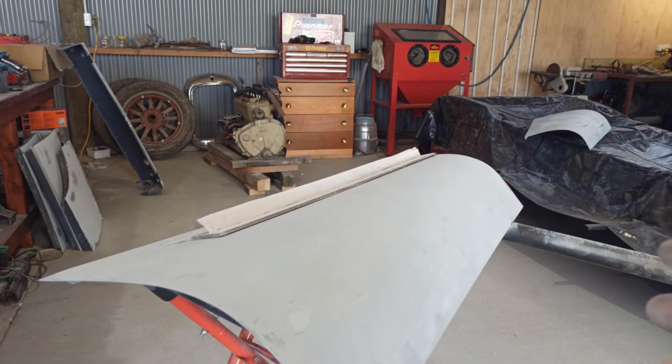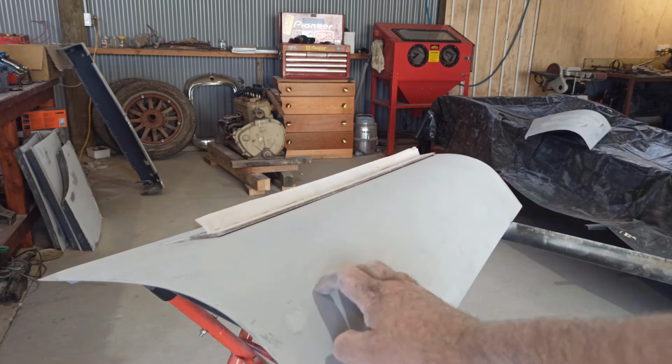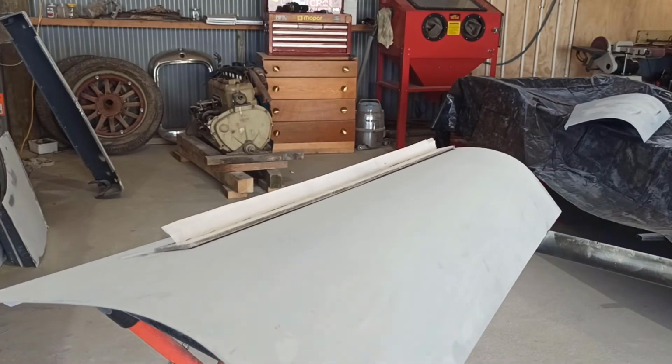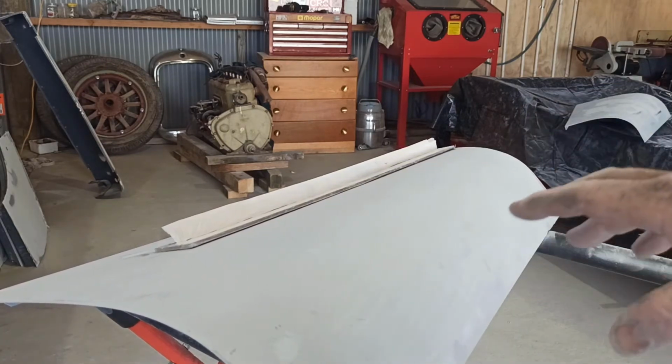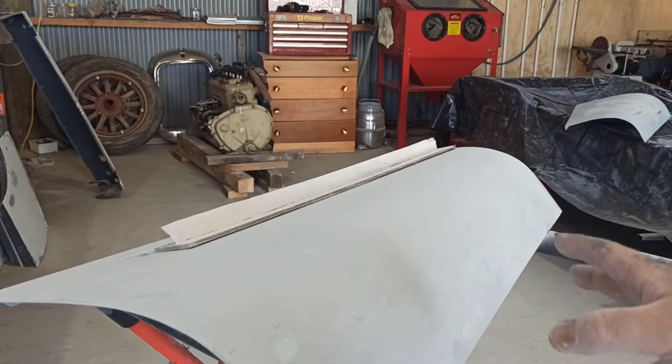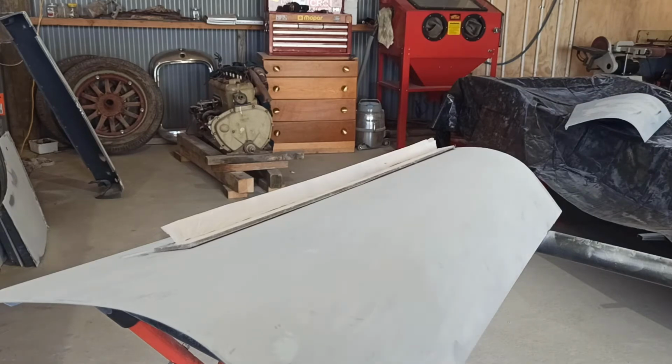It's where a nice paint job can become a very average paint job, because this part of it is 90% of your paint job. What I was saying there, sorry, it cut off for some reason: 90% of your paint job is the preparation underneath, and the last 10% is your paint and your clear coat and whatever. You can block that black and make it look really nice and beautiful, but as long as the understuff isn't right, what's on top is never going to be right, if you know what I mean. So 90% of your paint job is the prep underneath. The rest of it doesn't matter if this isn't right. So anyway, I'll carry on.